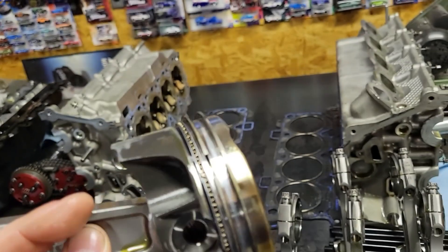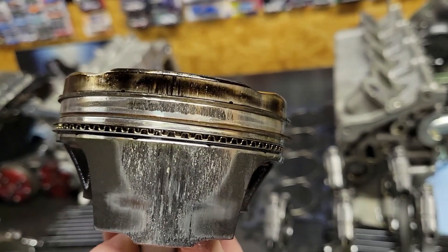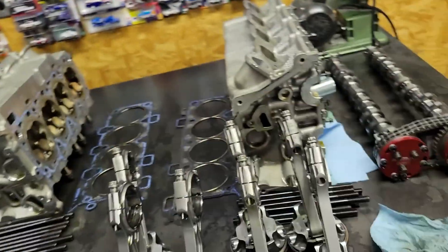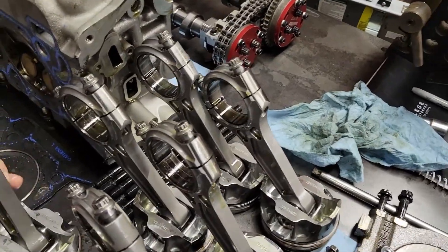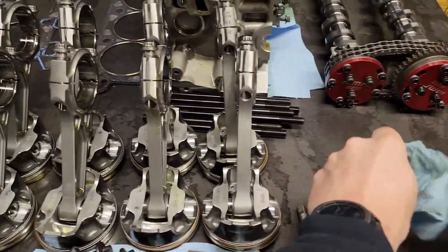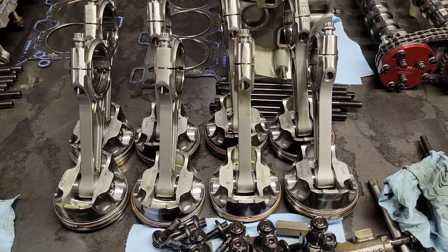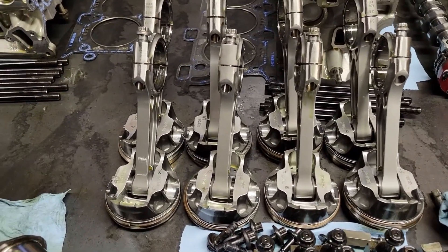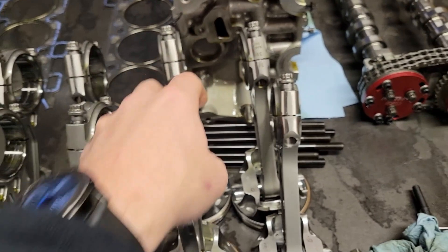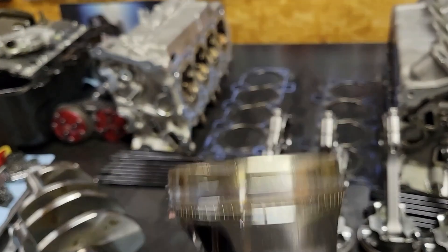This thing was making material when I first put it together and we couldn't figure out why — until now. I'm lucky it didn't get much worse. Other people have had issues with this specific piston — the mod2k piston in Coyotes — knocking the skirts off, and everybody claims it's a skirt profile issue. I tend to agree. These had varying piston-to-wall clearances intentionally: between 5.5 and 6.5 thou depending on the cylinder. The one that was a little worse was 5.8 thou, and the worst was the one at 5.5 thou.